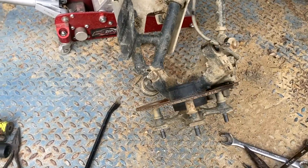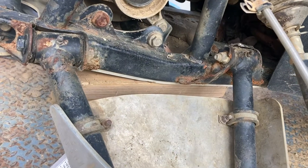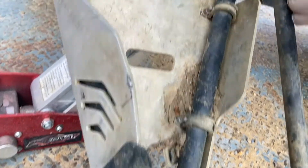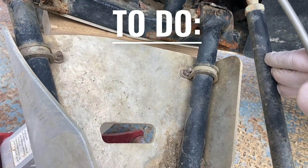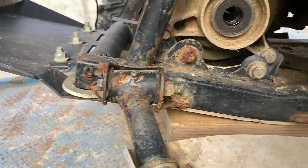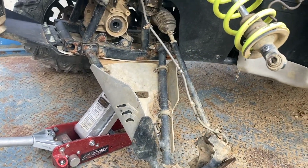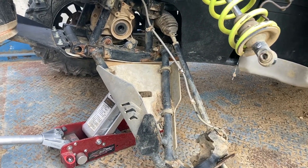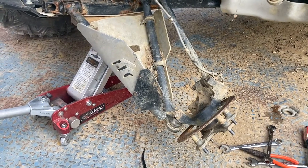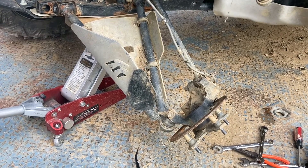When I got down to here where I can see, I had much more damage. See that bracket — it is definitely all bent up. For that little control arm, I think the control arm is okay, but I need to take that off and do some bending, welding, and heating to get it all back out straight, because it's supposed to be out flat like that one, and it's not. So it's never going to act right like that. It's going to take more time, so I'll go ahead and get that lower control arm off. I think the steering shaft is okay. I wish I could get it off the trailer to work inside, but if I put it back together enough to get it inside, I'm going to have to take it back apart.